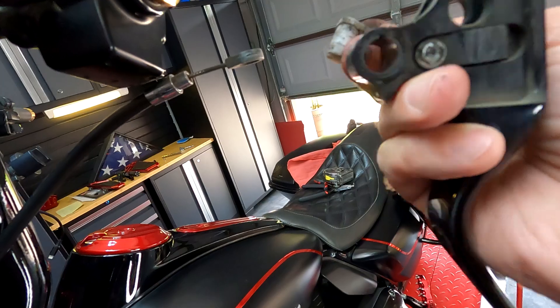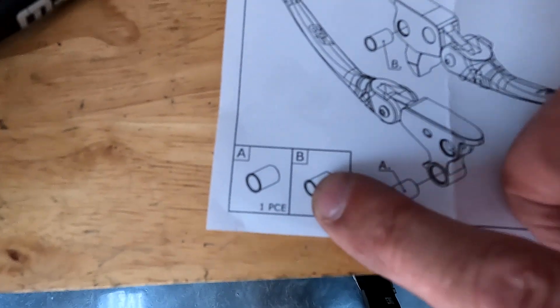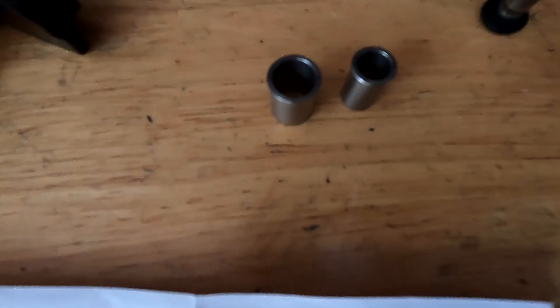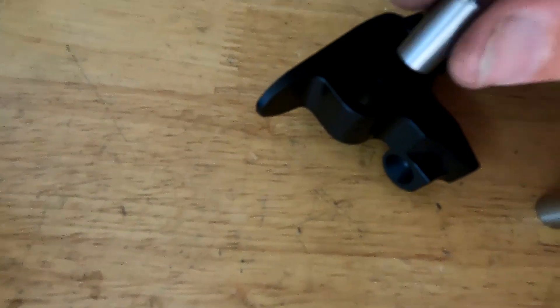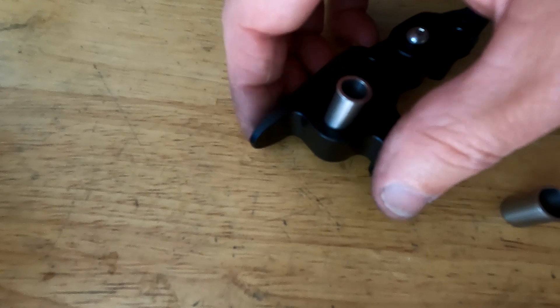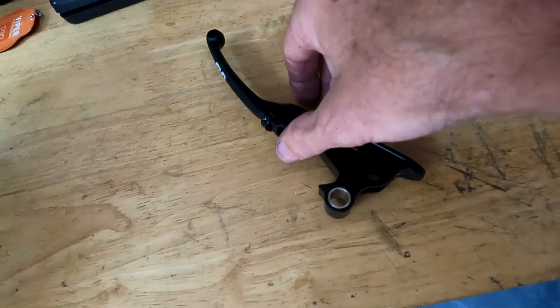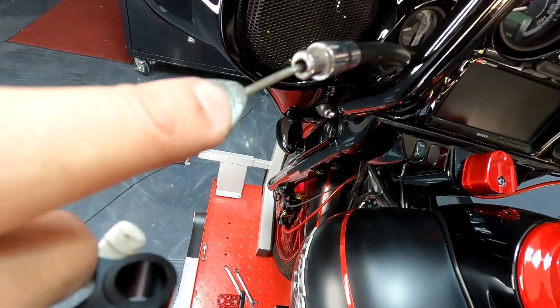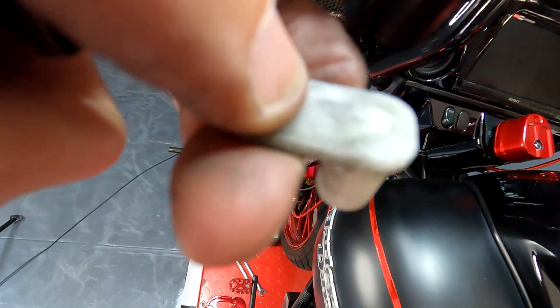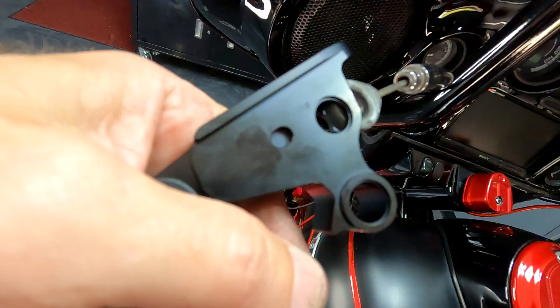Pull out this nylon piece and it comes right out. Before you put your levers on, note the two stainless sleeves it comes with — one big, one small. The smaller one is for your front brake, the bigger one for the clutch. The front brake sleeve has a little shoulder on the end — make sure that shoulder goes in from the top with the shoulder on top; there's a little groove in the lever bracket for it. Then your pin goes right in there nice and tight. For the clutch cable, the cable end piece goes in the lever, the nylon piece goes in the hole, and the little nub on the bottom of the nylon piece goes into that indentation.